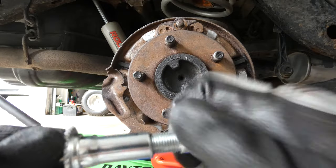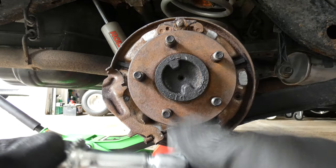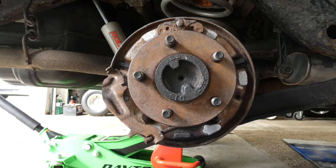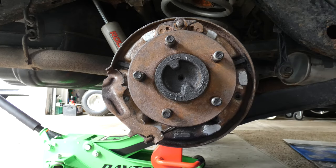This is the part that, once your brake pads wear down, it'll tighten and push them out a little bit. And I got some stuff on me. You don't want to get this on your brake pads themselves. So towel, wipe everything off. All right. I'm also going to put a little bit of anti-seize on this bit right here. There you go. Got a little bit of anti-seize on there. Very nice. Wipe off the excess.